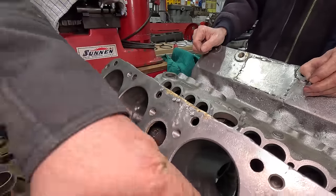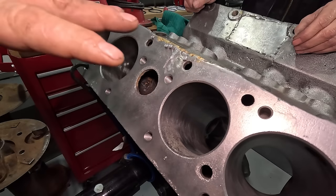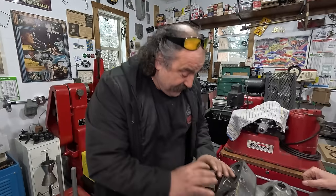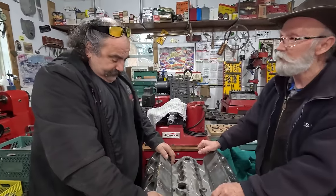I take it you're going to sleeve this motor? Yes, I have to sleeve it — looking right in this whole cylinder here, it's got some bad pits. Now, sleeving: you bore the cylinder out bigger, get another piece of round material, and either cool the material down or heat the block up, then shove it in or press it in. It does its thing, stays there, and you're good to go — then you just bore it to size.